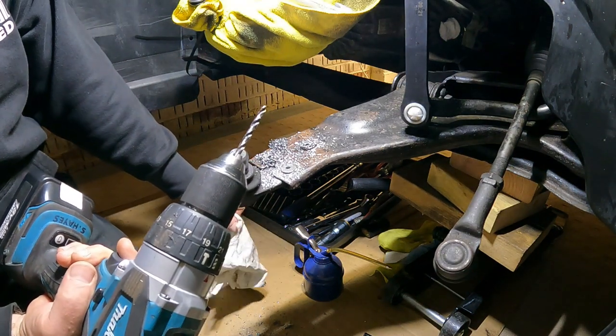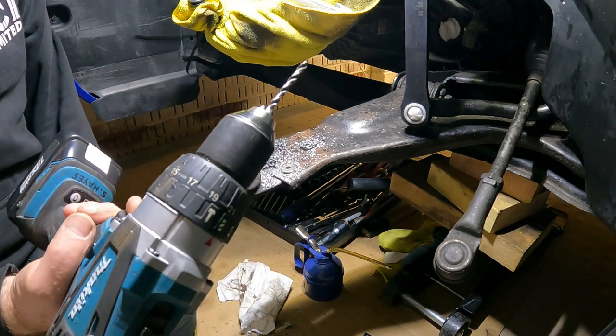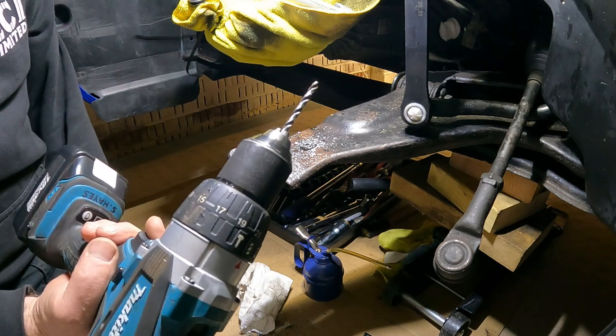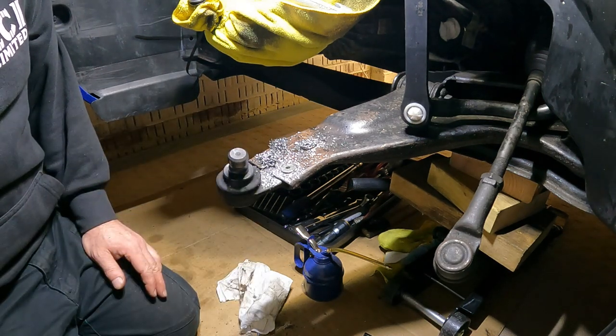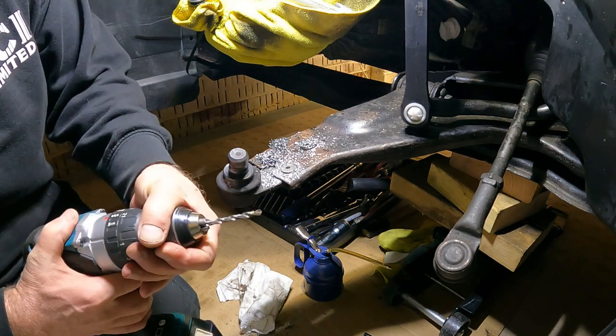Yeah, so keep adding oil as you go in. Look after these little drill bits. Use decent ones in the first place. I would say a minimum of 4mm, 4.5, because otherwise they just snap. Even the 4mm, so you gotta be really careful with them. Look after them, keep putting oil, keep clearing the holes, all the rest of it. Don't let them overheat. Keep that cutting edge nice and sharp.